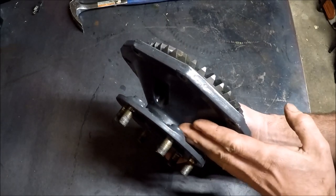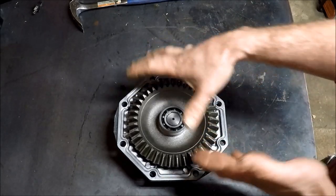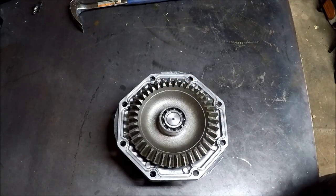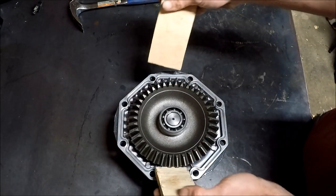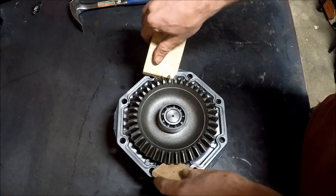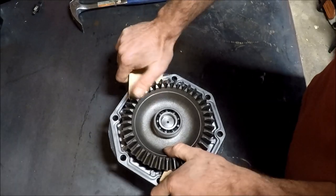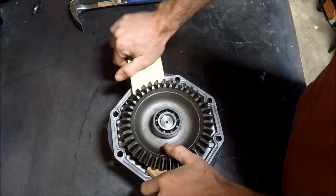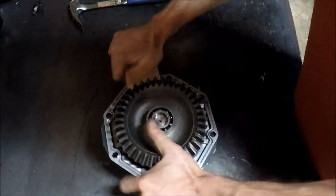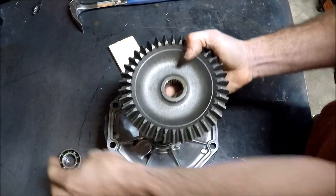To access the wheel seal in here, pretty straightforward and simple. I'm fast-forwarding now because apparently I didn't record it when I took this apart, so I've already got mine installed but I'm going to take it back apart to show you how easy it is to get to it. If you get a couple of thin pieces of wood like this, slip these under the bevel gear — yours might even just slip off. See how that popped up by putting some pressure there, and then with that play, just slap that up and it should pop the bearing off.